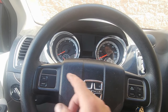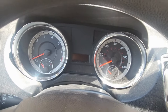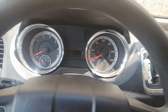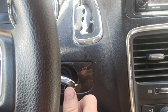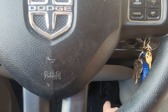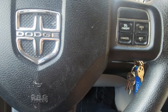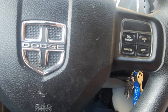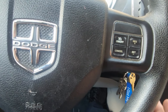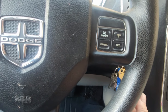With this one you're not going to use any of the buttons like most are — you're actually going to be using the gas pedal to reset it. You turn it two clicks and then within five seconds you hit the gas pedal all the way down three times. You want to space them out; you don't want to just slam it quickly three times, you want to do it steady.